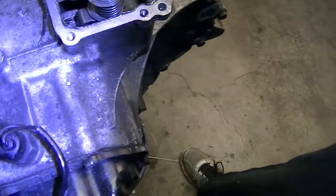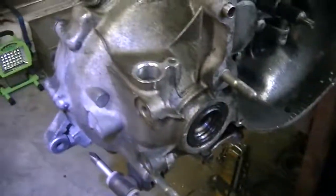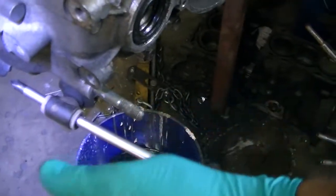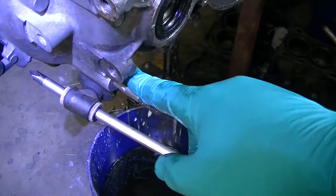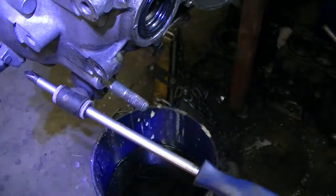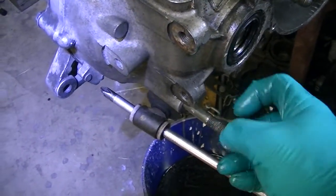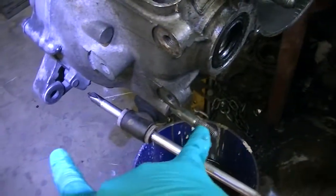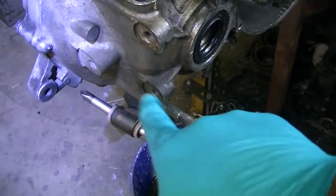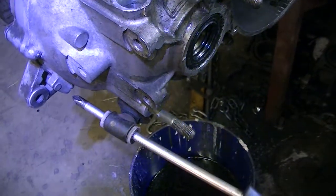Also on the four-cylinders, when you're putting a tranny in, you need to move your shift linkage stud from your rod — this is your shift linkage — and then your stabilizing rod to the transmission from the shift housing. You take that stud out right there and you relocate it into this hole right here; that's what that's for. You just put two nuts on here, tighten them together, and then back the back nut out — that'll unthread your stud. Put it right back in there. And that is the difference in distance between a four-cylinder and a three-cylinder engine, and that's why the axles are a different length and the engine mounts are that much longer. Hope that fixes you up and you'll be back on the highway.